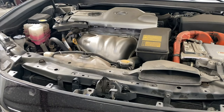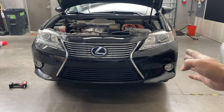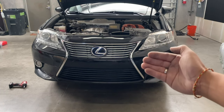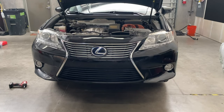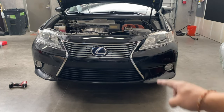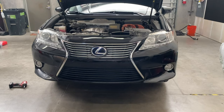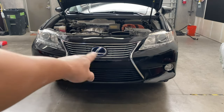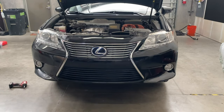Let me show you guys how to take it off. On these bumpers, we're going to pull one side first, then go to the other side and pull that off, and then slowly pull this bumper back. Because you have sensors here also, you don't want to yank the bumper off. There will be connections that you're going to have to take off — especially the fog lights, the sensors, and maybe even adaptive cruise control sensors.